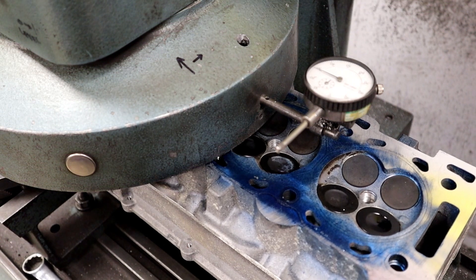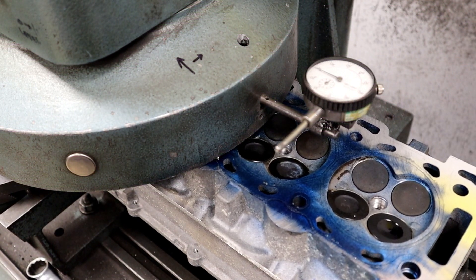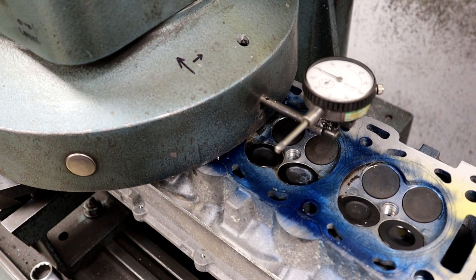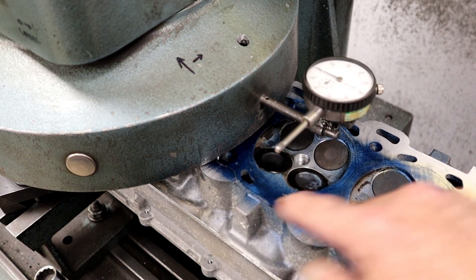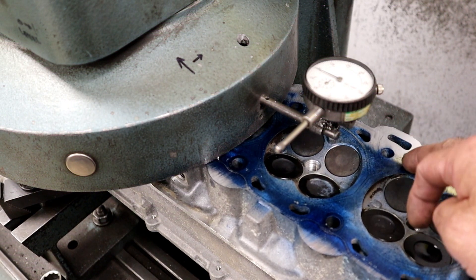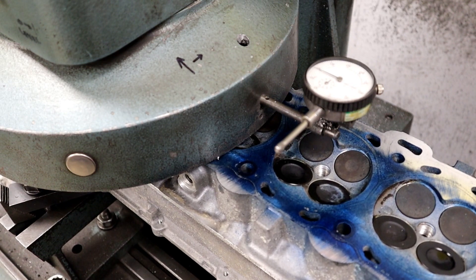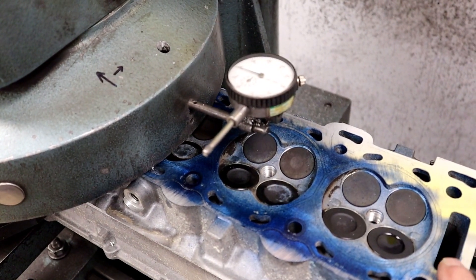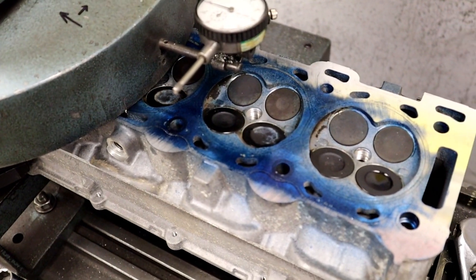The technician took Scotch-Brite and it looked beautiful — smooth, shiny. The more shine you put on it, the better, right? But what happened when he torqued the cylinder head back down with a brand new head gasket? All the clamping pressure was concentrated at the high spots — here, here, here — but it had no load at the low spots. The PSI and pressure which should be around the seating ring was not there, and it leaked. On the other head, we actually had two low spots passing combustion. You can see here we're probably going to have that on this head as well.